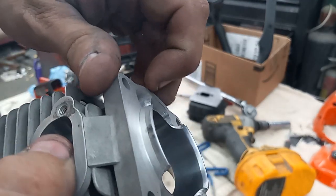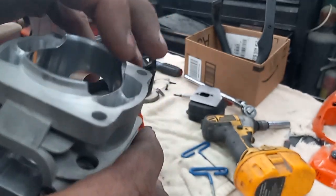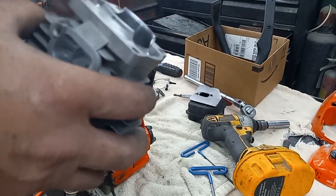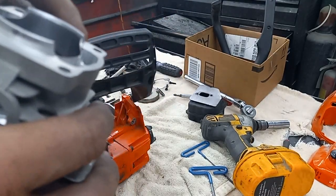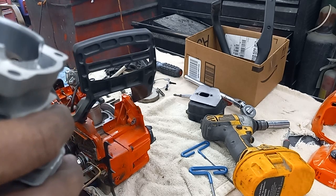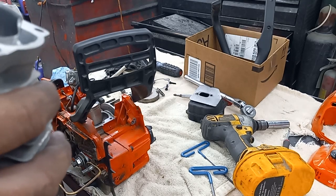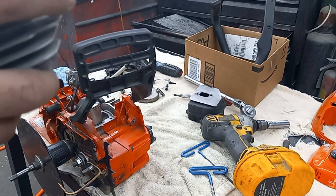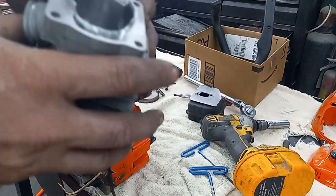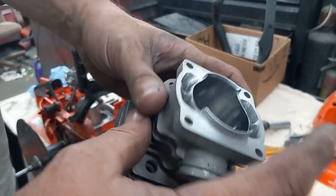I dropped that web a little lower than I typically do. On V8s, when I used to build V8s, the web on a dual plane intake — if I was forced to run a dual plane intake — I'd cut a little notch out of the webbing. I'd go in about a half inch, down three quarters of an inch, straight across the belly and then up, rounded. And believe it or not, that would make about 25 horsepower gain on a dual plane intake on a 350. So, miniature scaled-down version — I'm going to try it on the transfers on these.